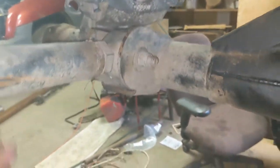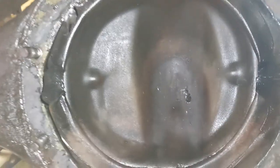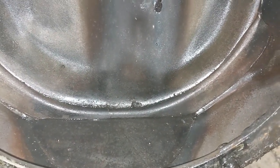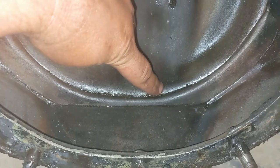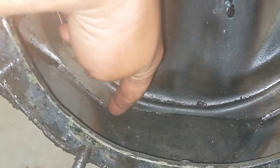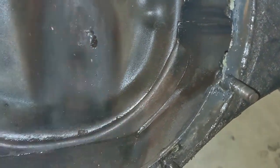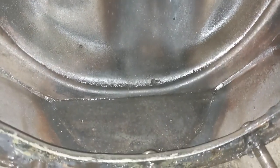So we went ahead and stripped this nine inch — we pulled the axles out by taking the four bolts off the flanges, pulled the third member out. We're actually going to get inside here and weld in here too. It's still leaking on me and it's making me mad, so I'm just going to do it right — pull it apart. We're actually going to weld this seam. You can see right here a little nick where we cut. You can see this is two pieces of metal — this piece on top of this piece. So we're going to weld this entire seam across here, and weld over here a little bit and up here where we burned through. That should stop it from leaking.